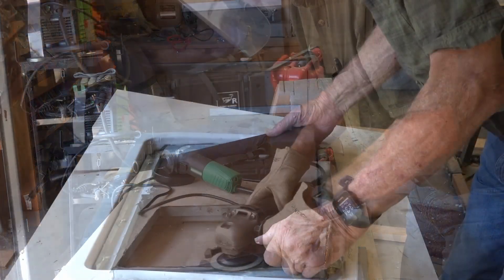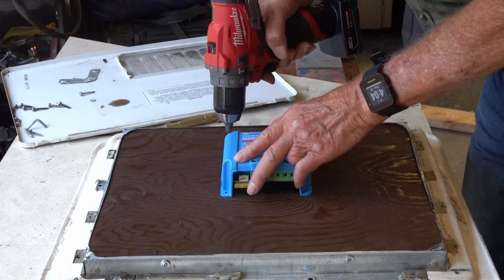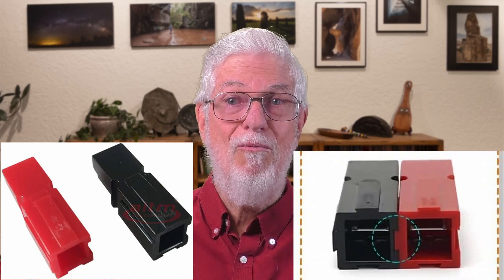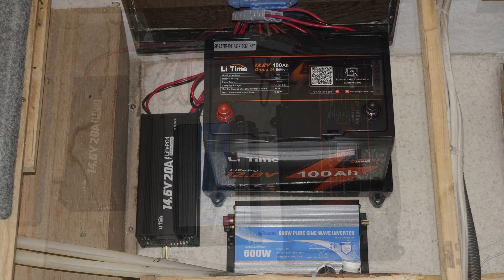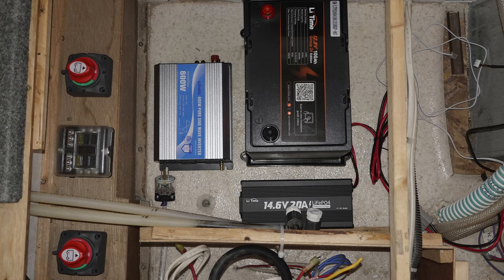Because this panel was going to be awkward to access once screwed back on the camper, I mounted the Victron solar controller directly to the inside of the panel and ran a wire through a hole to an Anderson connector on the outside. I like these connectors because they're easy to plug and unplug, and once assembled you can't plug them wrong — though you do need a crimping tool for them. This bit was the most work in the entire project, but at this point there was now a large volume of space available for mounting all the components. It took a bit of fiddling to decide how best to locate them, and eventually the choice came down to an arrangement that would keep the wiring short, not slop over into the other side of the compartment, and make it convenient to reach the switches.